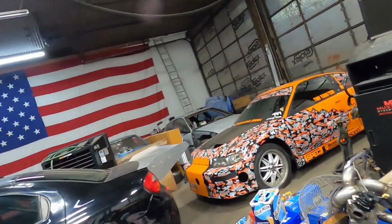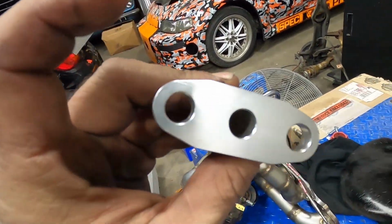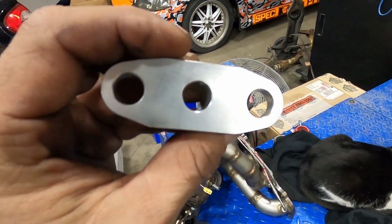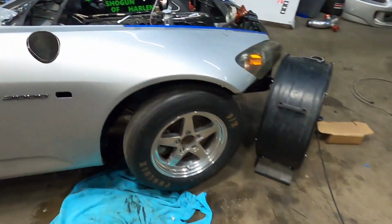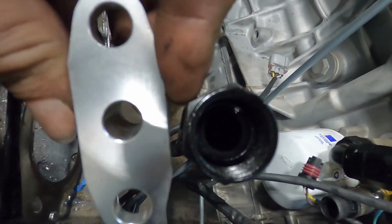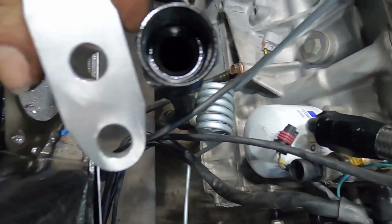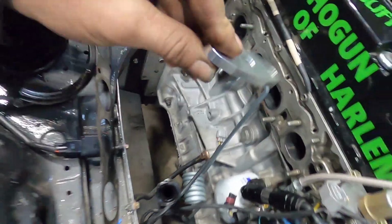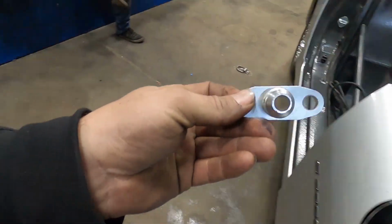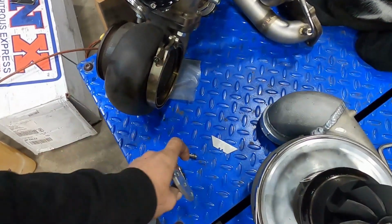And then looking at the turbo oil drain, I also noticed, look at the size of that hole. The bolt holes are bigger going through that. And if you compare the size of the hole in the hose, it's ridiculously different. So I may have been backed up a little bit as well. I'm not too stoked on this fitting, but it was on there. It might have been used for fabrication, I'm not sure, but it was there. We tightened it, we never pulled it off.